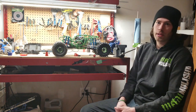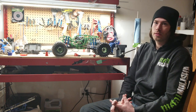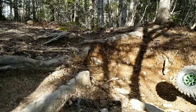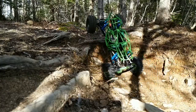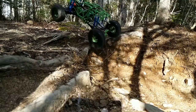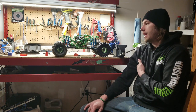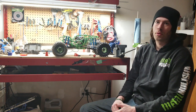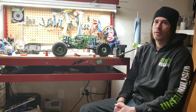I'm running two springs on this one, something I've not really done before. So my spring coilover side, I'm running a 10 weight, fill it up about halfway with oil, just to give it a nice hard dampen at the first initial hit, and then the rest of the shock travels pretty plush. And then in the bypasses, I'm running 30 weight filled right up, so it gives it a nice slow rebound, but also you're allowed to hit stuff a lot harder, and you're not going to have the buggy topple over backwards or anything like that. The axle's going to take more of the work, and then your shocks are just going to be able to kind of cover that and make it nice and smooth.